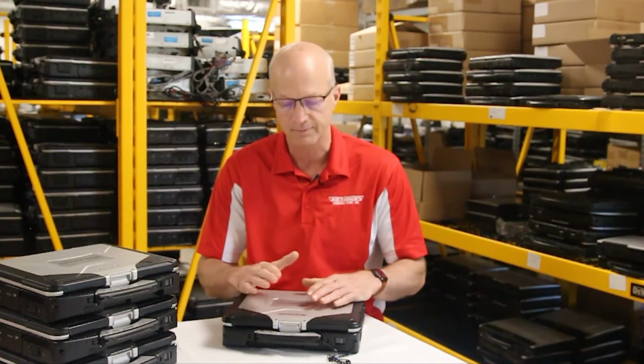Another thing I would do is definitely double check my USB device and make sure it's operating properly. So try a different computer with your USB device, make sure that is not the problem, and you may be spinning your wheels otherwise. So that's what I would do.